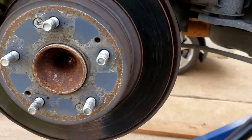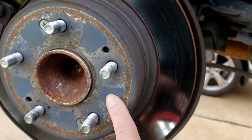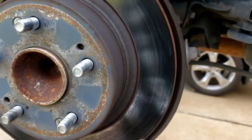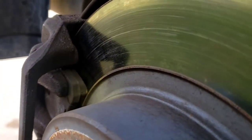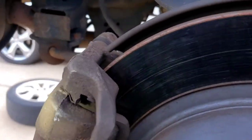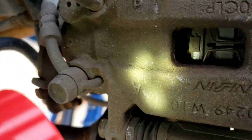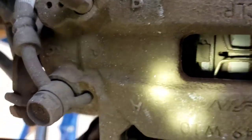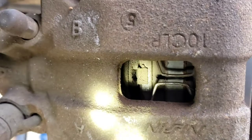Right, off to the rear. The rears look like they've been changed — this looks like the AutoZone coated one, you can see it's coated. It's in good shape. The brake pads are good, they're not brand new but they are good. It's got the proper clips on there — that's the inner pad, that's the outer pad, right up against the rotors.